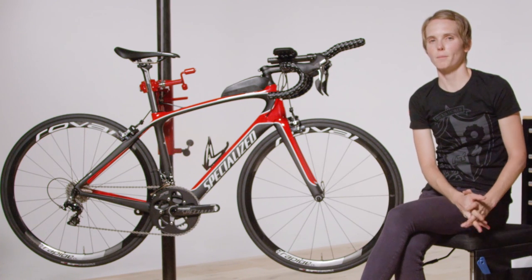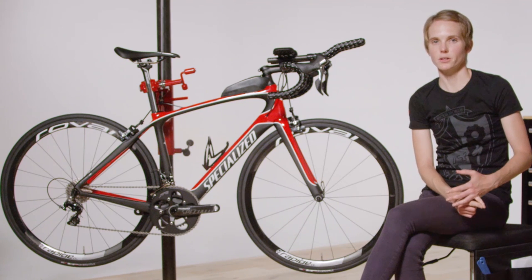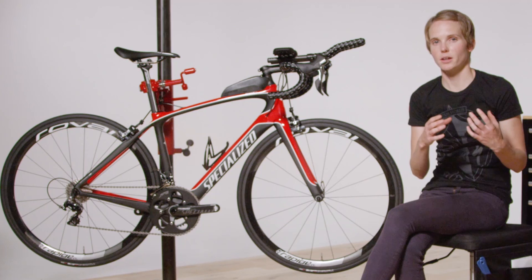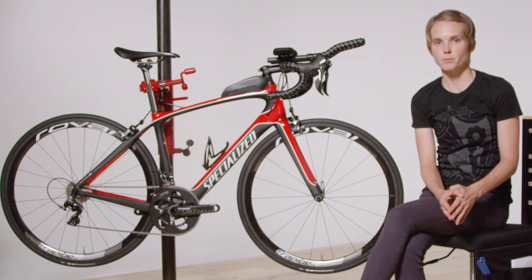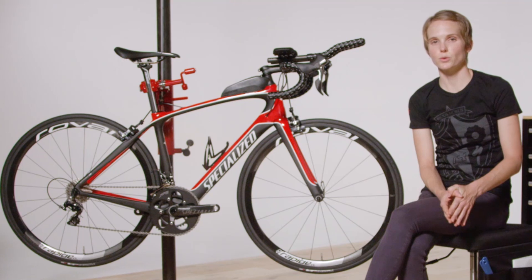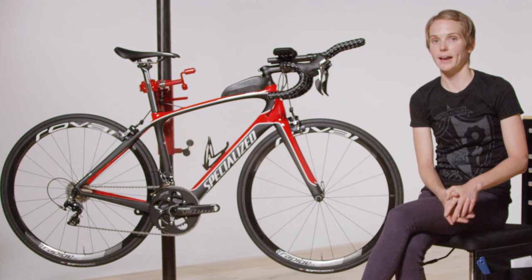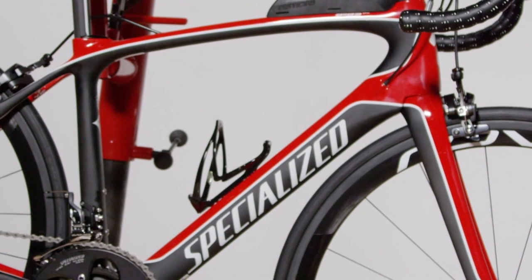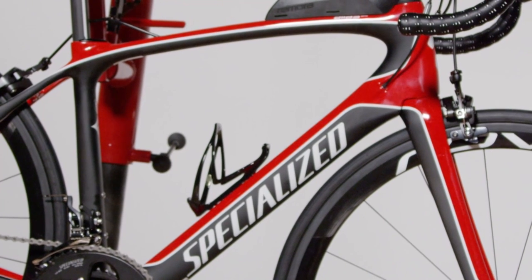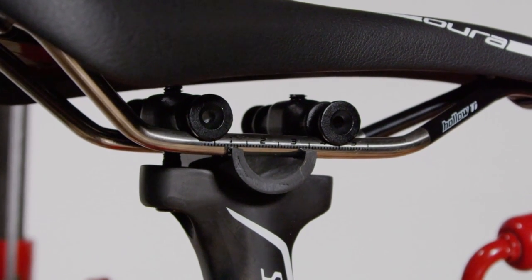During the development process of the bike, we looked at the fit of riders on road bikes with clip-on aero bars. We used our SBCU team here in Morgan Hill and we set riders up on road bikes with clip-on aero bars and analyzed the adjustments that they needed to make to get into that aero position. What we saw was that most of the riders needed to move their saddle forward three and a half to four centimeters to get in a position that was ideal for use in aero bars. We took that information and built a geometry around that aero position so that the bike handles well in the aero bars. That led us to a 77.5 degree seat tube angle on the size 51 — a steeper seat tube angle than you're going to see on most road families. When you pair that steep seat tube angle with a zero offset post, it puts the rider forward in that more triathlon position.